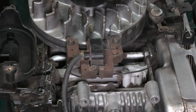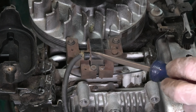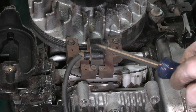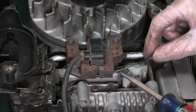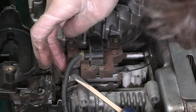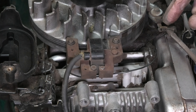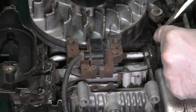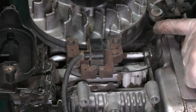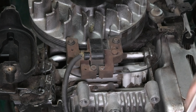Here we have the armature, the coil itself in the middle — the black piece here. Below we have this little black wire, that's the kill switch wire. We want to make sure that this is correctly assembled and connected. If it's loose and leaning against something else, that may already be the problem. Make sure this is connected right, otherwise there will be no spark.